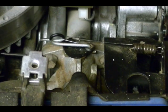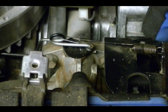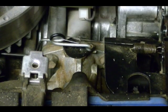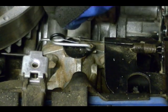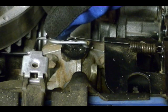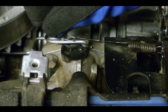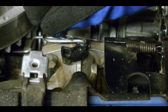An important thing to remember with these governor systems on small engines — it's the same for mechanical, pneumatic, or electronic governor systems — the spring force, the force created by the spring, is always used to open the throttle wide open. Right now this throttle is in a wide open position. If I were to start this mower, the governor would kick in and oppose the spring force, pulling this throttle to a more closed position. When the spring force equals the force created by the governor, the throttle stops at a specific position and the mower runs at a relatively constant RPM.